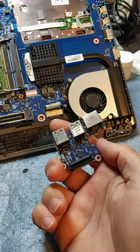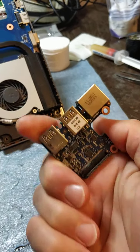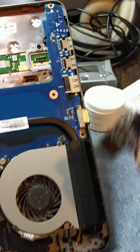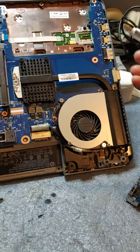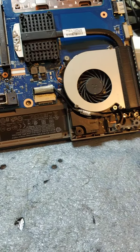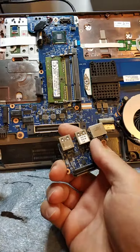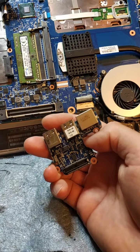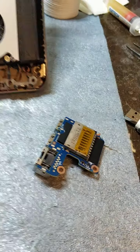This model has two USB ports and a network card. I have two USB ports here which I used for BIOS recovery. All my problem was because I wasn't putting this expansion card back in.